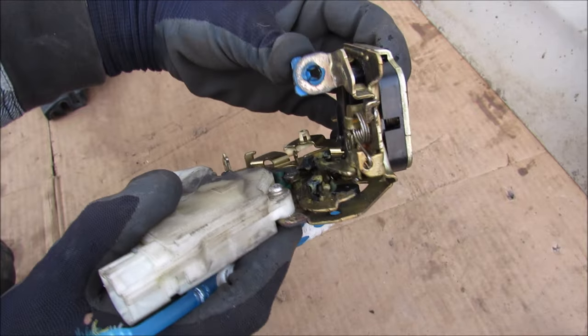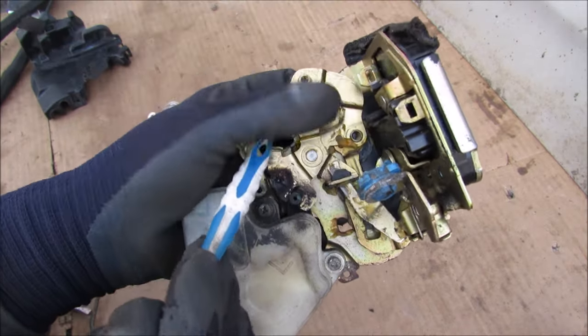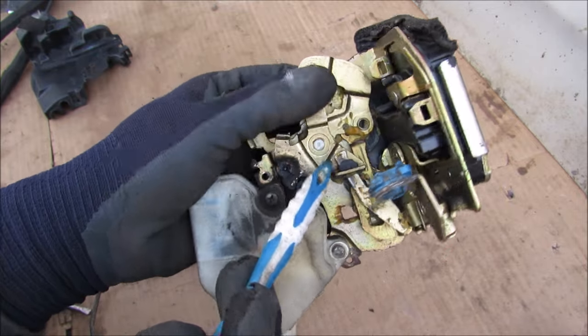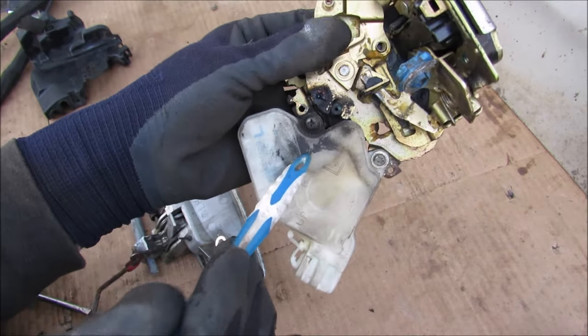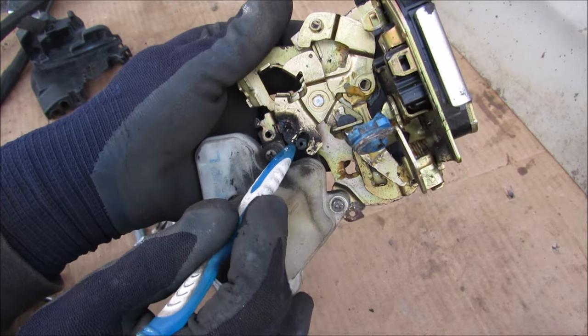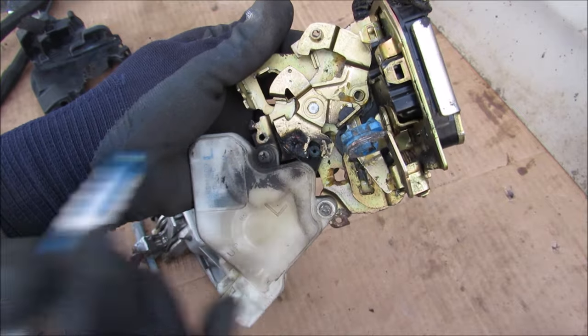With child lock engaged, the exterior door handle can still unlock the door. The interior door lock cable connects to a cam that pivots about the main pivot point and has a third connection that goes to a lever electronically powered by a motor inside the lock actuator. Therefore the lock actuator can power up and give you power door locks electronically by moving the mechanism back and forth.